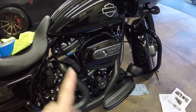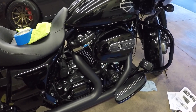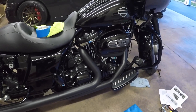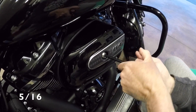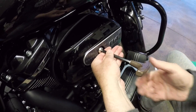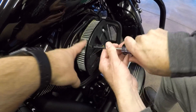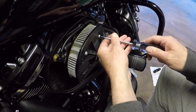So we're gonna go ahead and do the air cleaner next and then flash it with the tune from Fuel Moto. You want to do both of those things before you start it up because the bike isn't going to react well with the stock tune and this new two-into-one header pipe. So we're starting on the air cleaner now and you need a 5/16 Allen wrench to take the main bolt out. In order to take the air filter off you need a T25 Torx bit driver.